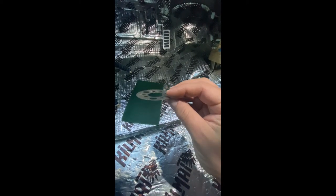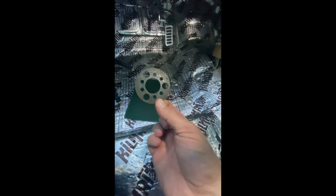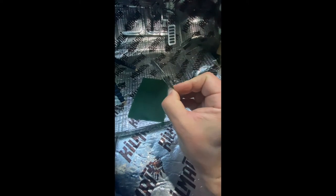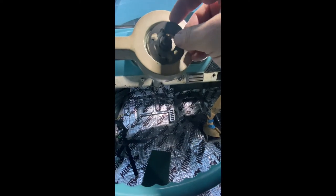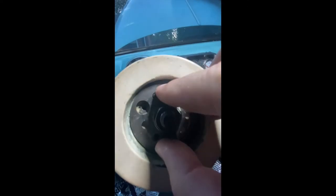The next piece is this metal disc — I'm not sure of the technical term — but it has multiple holes in it, specifically three larger ones, and it should have a slight concave bow to it. The three major holes are for the set screws and those need to be lined up in position. You place it right behind the contact switch, careful to line up the holes.